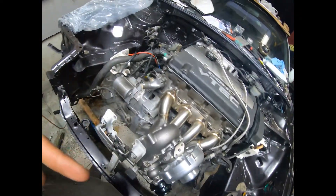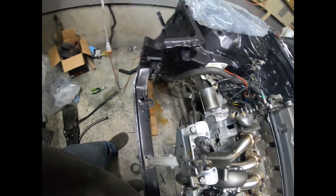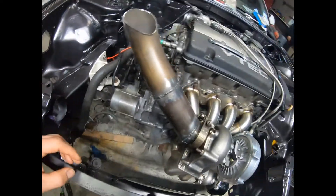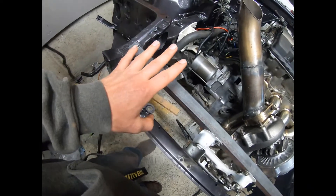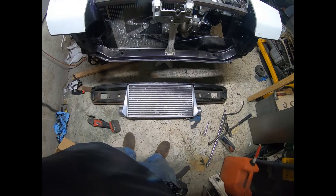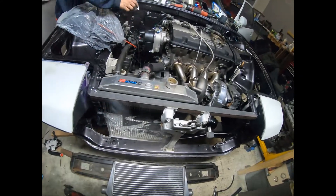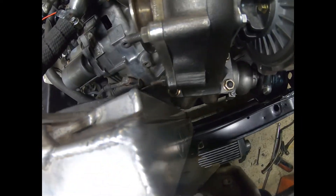Tomorrow the main goal is getting the radiator all done. Getting some of the core support mocked up — got a piece of steel going around to where the hood's gonna go so we still have our factory hood latch. Got a temporary up-pipe made. Now we've got to finish off the radiator support and build something up top to help hold it in place. The intercooler is getting mocked up and the radiator has pretty much found its home. We'll monitor coolant temps during the tune but it should probably be good.